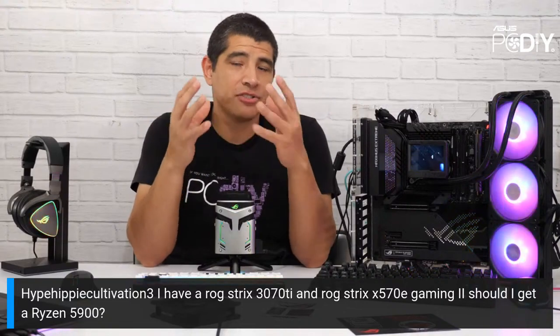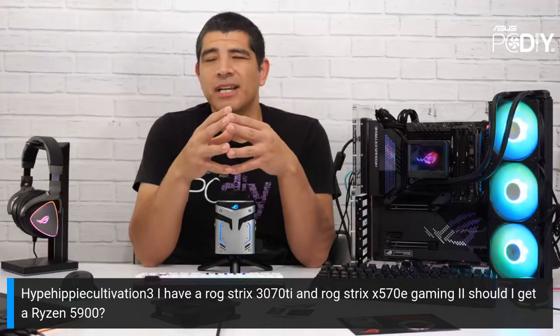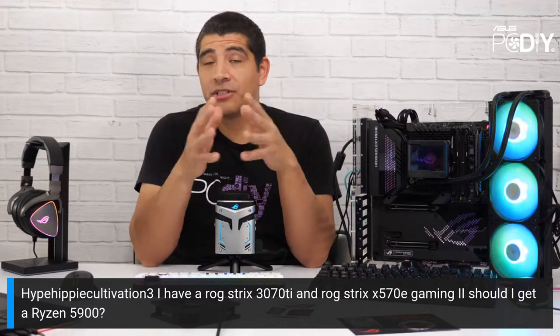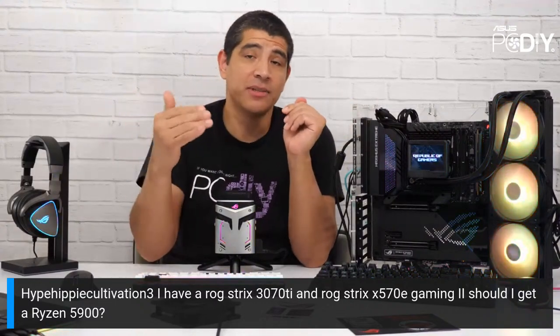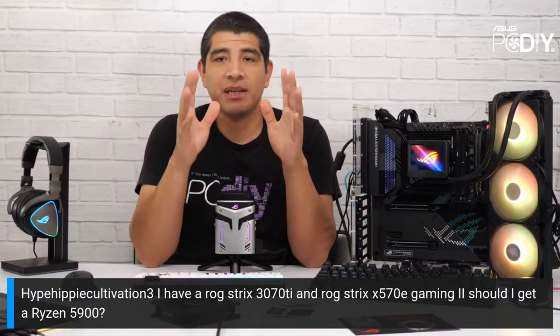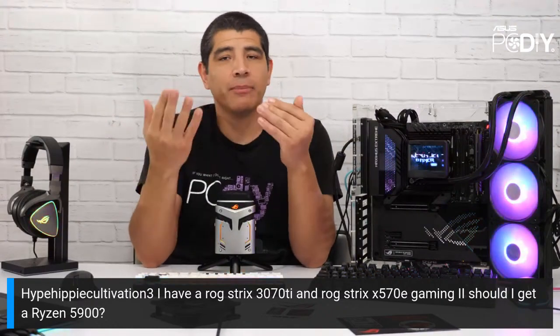There are a few games that do have very good multi-threaded balancing. So Civ is actually pretty good. You'll find a lot of the Total War series of games are pretty well distributed across a wide number of threads and scale relative to performance, with the best performance on CPUs that have even more threads. But historically, most games are generally going to be in that sweet spot of about 4 to 8 threads, and then it's going to be all about frequency.